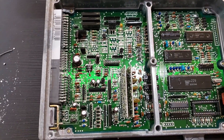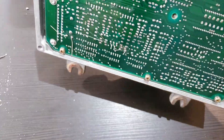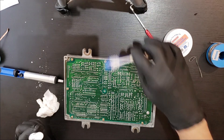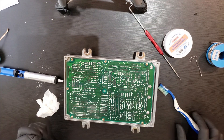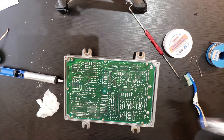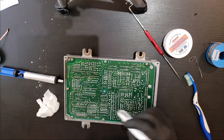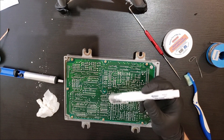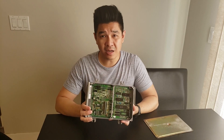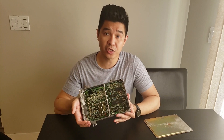That's basically all converted to VTEC now. I'm just going to snip all the wiring on the back since it's messy, and then we're done. The final step is to scrub all the soldered areas with rubbing alcohol or isopropyl alcohol, then conformal coat all the newly exposed areas since the original conformal coating would have burned off during soldering. Using this conformal coating pen — there you go. Here's the fully VTEC-converted P06 ECU using the BM Tune VTEC conversion kit for the 1720 board.